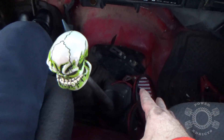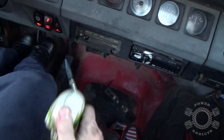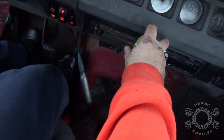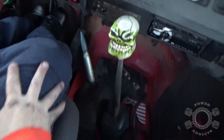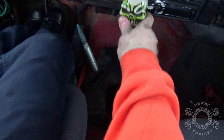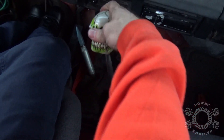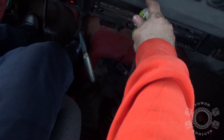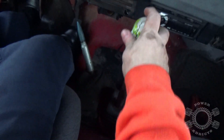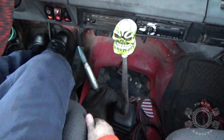Right now it's cold outside, and that boot isn't allowing the shifter to come back like it wants to. Once the Jeep warms up and the boot warms up, it does just fine. Let's see — third, second, third, first — still a little bit notchy. Like I said, the synchronizers are done in this transmission. It is easier than it was before, but it still doesn't like first gear a whole lot. Let me try a straight shift from third to first.